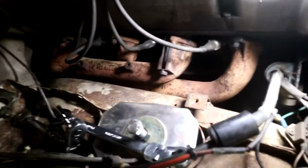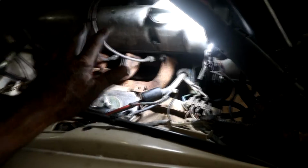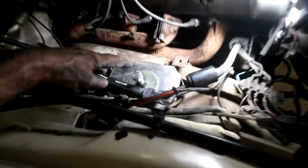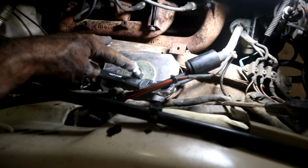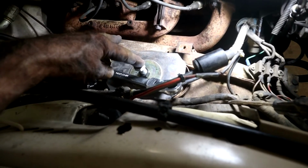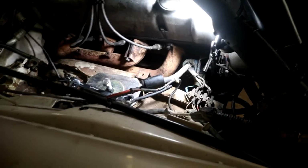So next thing, now the engine is just supported by a steel bar setup underneath and the rear transmission mount. Now it's just sitting there, so it's anchored, no problem. Next job is to lower the subframe, remove our support plates, or support the subframe first obviously with a jack, and then we can remove these and gently lower the subframe to the point where it exposes those subframe mounts, and switch those out. And we'll get our other engine shock absorber off the passenger side. Check that, that's probably knackered as well.